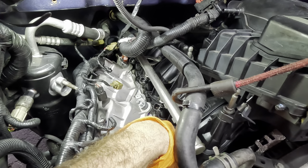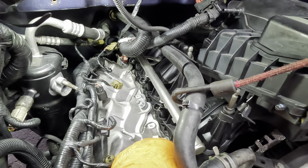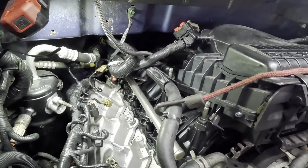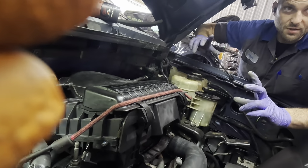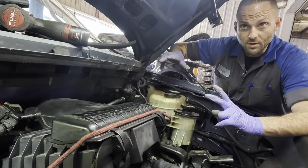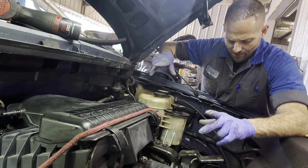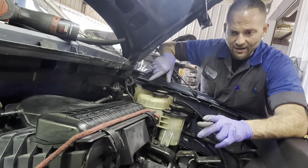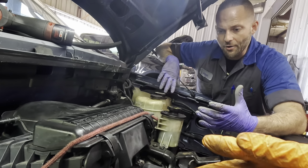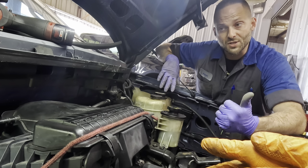All right, this is a 4x4. I got no codes. I have the vacuum gauge backing down to the hubs. I have manually locked it in, put it in 4x4, jacked the front of the truck up, and realized that the axle shaft spins. So yeah, that means it's locked mechanically to the hub. Now I'm trying to prepare the other side, and I have the same thing, but now I'm comparing how fast this vacuum gauge is pumping up to each side.